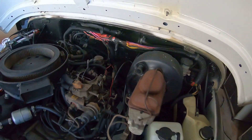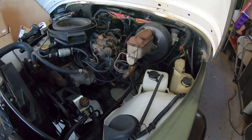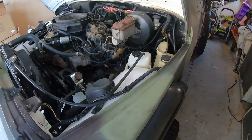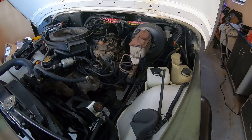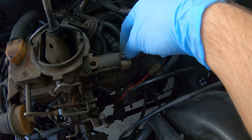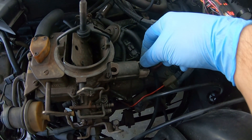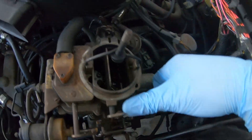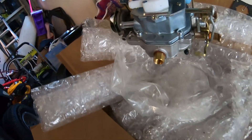Today we're doing a Nutter Bypass on a 1987 Jeep Wrangler YJ. The vehicle is exhibiting some strange drivability issues such as sputtering and lack of power. These vehicles have some very strange pre-fuel injection emissions controls like this stepper motor right here on the back of the carb. This actually meters how much fuel comes into the carb — it's kind of like a pre-fuel injection feedback control system for carburetors. We got the same carburetor remanufactured but without that stepper motor, just to rule out any other carb issues.